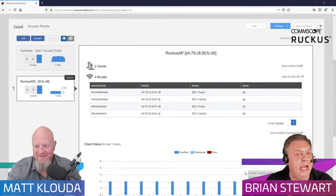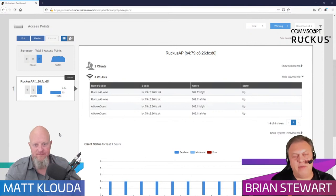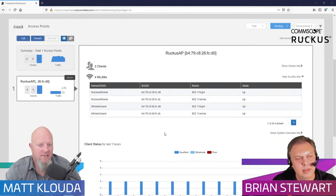If you've basically lost your brains because of the power outage, you may need to get back into the 7150 and set it back up to be able to get to the web UI. But once you've done that, you can do it all through the web. So if you're not as comfortable with the command line interface, once you've got your way into the web UI, it can be a lot friendlier and easier to turn on power and do all those kinds of things there.